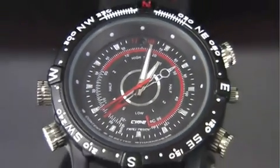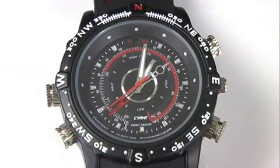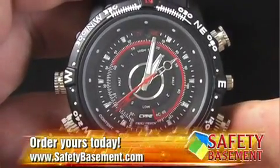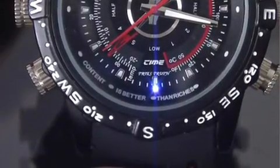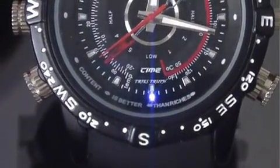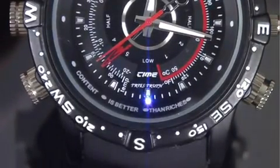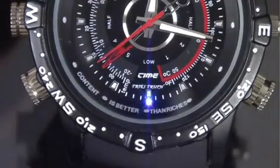Finally, we can also record audio only. It's easy to record an important meeting or conversation with a high definition video watch from safetybasement.com. Just screw on the microphone knob — it's the one with the center hole. Now press the power button. We'll need to switch from photo mode to audio only mode. Just press the mode button a few times until both the red and blue lights are on. To start recording, quickly press the power button. The status light will blink red, blue, red, blue a few times, and then go dark.